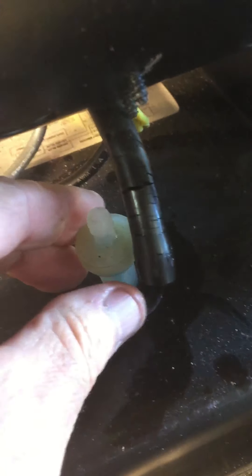This right here is your fuel filter. It just pushes in and out, snaps in and out like there. See how this is dry and split. Putting the fire up — it's getting spark coming out of the spark igniter. It's sparking so it should work, but it ain't getting no fuel. The reason why it's sucking air and ain't getting no fuel is that right there.